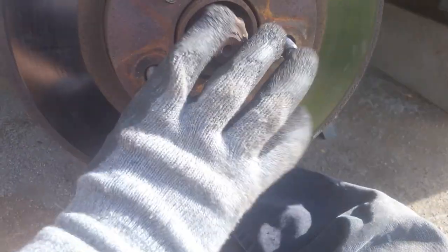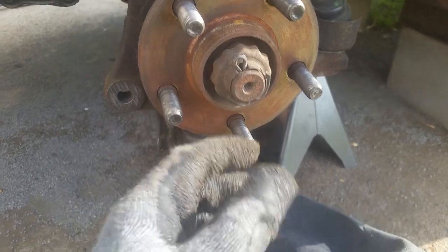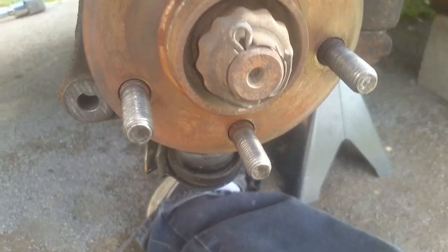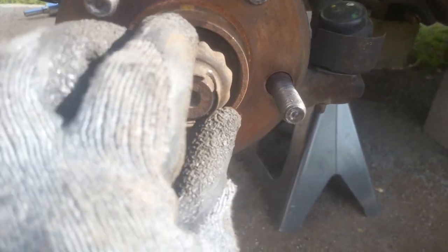Just wired it right through there so it's not falling down on your head. Then we're ready to go ahead and get the rotor off. Next we'll have to bend this cotter pin — that will just slide right off. We're just going to bend these out with some needle nose, straighten it out, and then pull it through and slip this anti-spin contraption off of there.